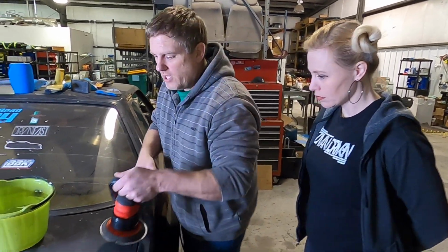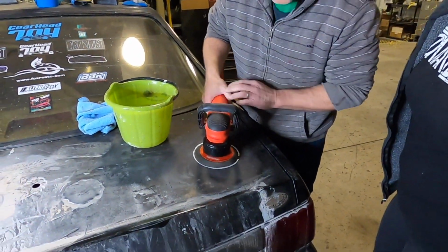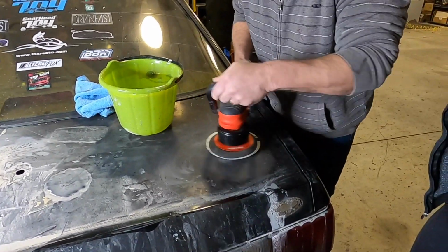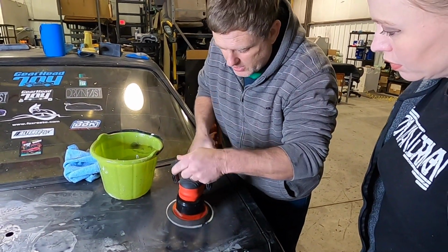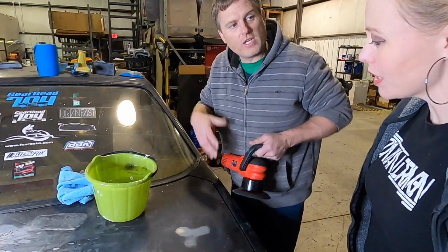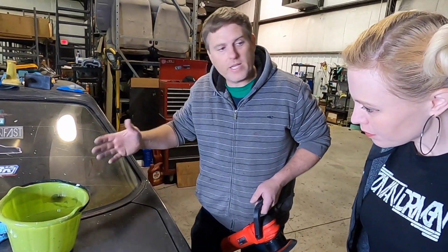And when you're working it, you're not going to work it like this. You see how I'm not moving off the spot. I've got it covered. So you're not going to sand, and then look, and then sand, and then look. That's a great way to blow right through. When you start getting close, you're going to sand, wipe it, and keep going like that, so I'm exposing it. This way, when you're sanding, you sand away a little and re-inspect it, sand away a little.